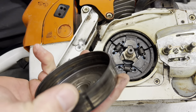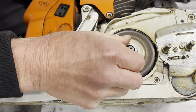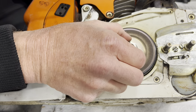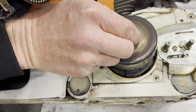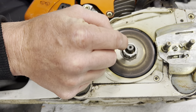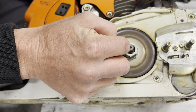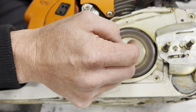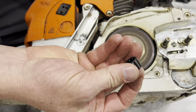That wire has moved, so I'm going to turn it back down to the 6 o'clock position and grab the drum assembly. You can see that notch on there and a little hash mark on the front of it. Put it down on that wire — the problem is you won't feel it catch; it'll only sit cockeyed if it's not aligned. Once it's lined up on the wire you can feel it flush. It will firm up when I put the needle bearing on.